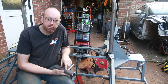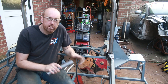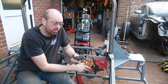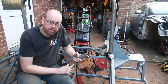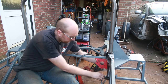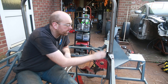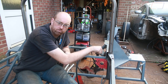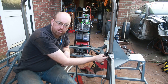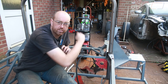Now the main hoop is tacked in, we can add a couple of supports to join onto the very bottom of the car — not just onto our main chassis supports for the engine. I've cut and shaped these because there are a few bits we can't get into with the grinder and files, but it all matches up really nicely. The design is so that it comes directly down underneath this tube and runs straight in for maximum support. If we'd left the inch box tube under there, it would have sat right underneath the middle of this tube and in any crushing impact the box could have potentially gone straight up the inside, which is no good.